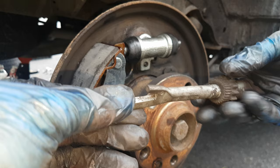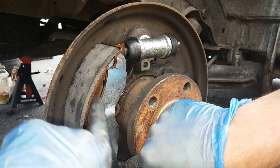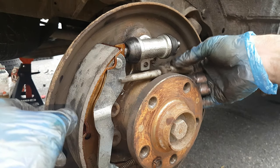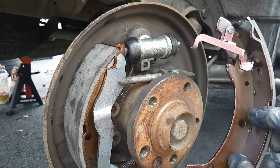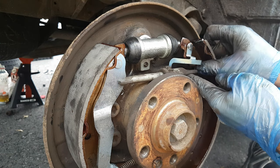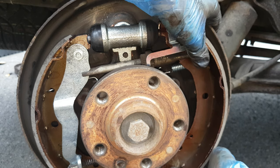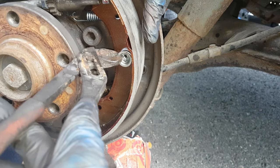After I clean this adjuster, you can see there is a kind of fork which goes on the pad over here. Behind here there is an indentation in the pad — that little hole is squared in order to make space for this arm, and it stays in there. It does not move up and down. On the second pad there is another indentation which goes on the adjuster.